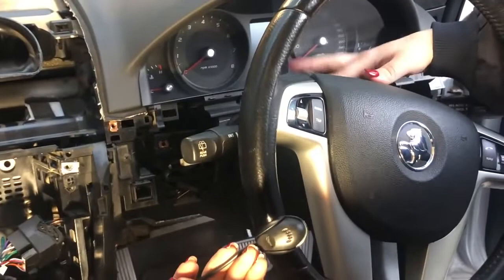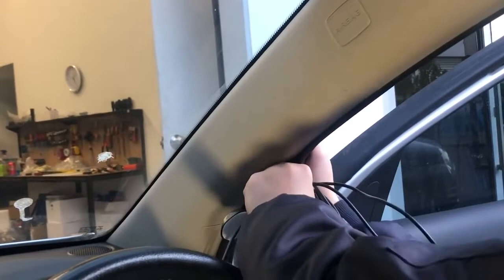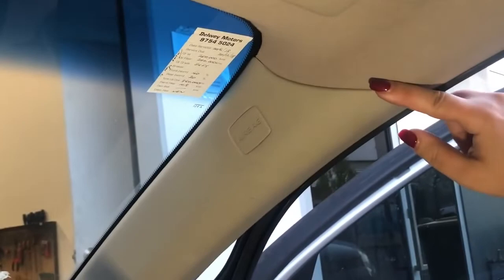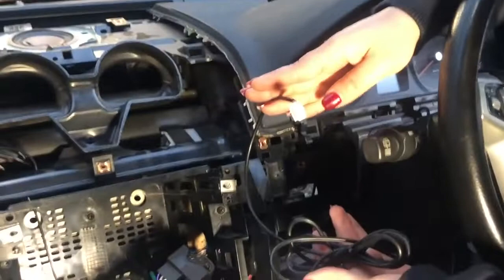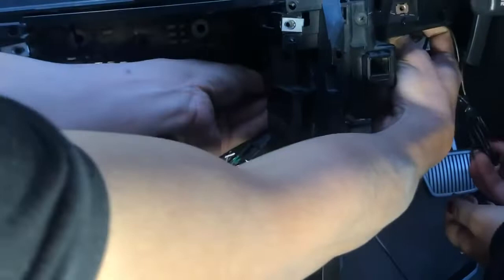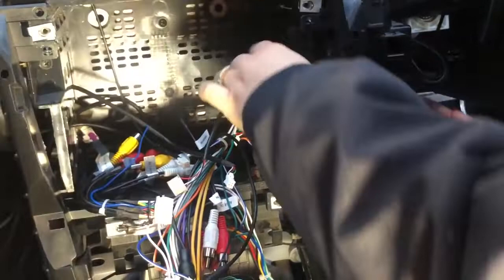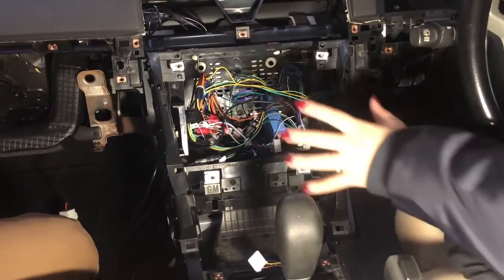Run the wires from the back of the metal plate, make the extra cable sit right underneath, and have the connection pull down here so we can connect it at the back of the unit. For the mic, you have a few options — you can run it all the way and put it on top of the steering wheel at the back of the plastic, or you can take the side plastic panel off, pull that rubber off, and run it through underneath the plastic. Today I'm just going to have it at the back of the steering wheel on top of the plastic.